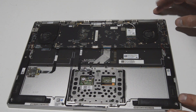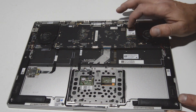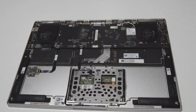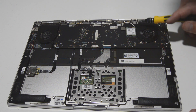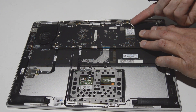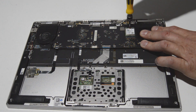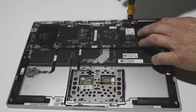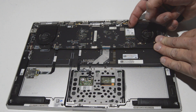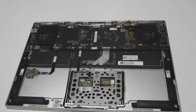We've got a couple of cooling fans we can remove next. The Wi-Fi card looks like it needs just a single screw, but one fan screw is partially underneath the Wi-Fi card, so we'll remove the Wi-Fi card first. Pop up the antennas and remove the screw, then use your fingernail to push on the Wi-Fi card and pull it free.